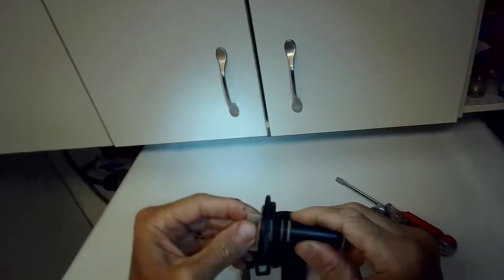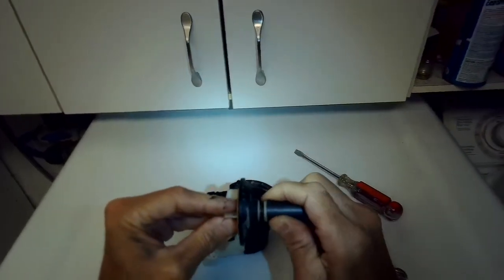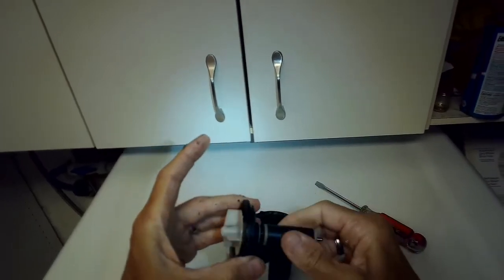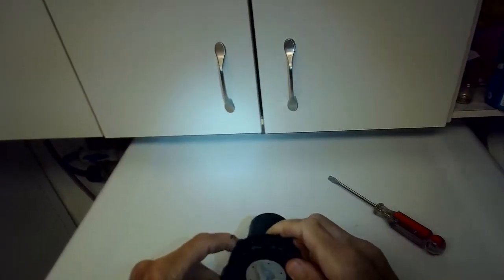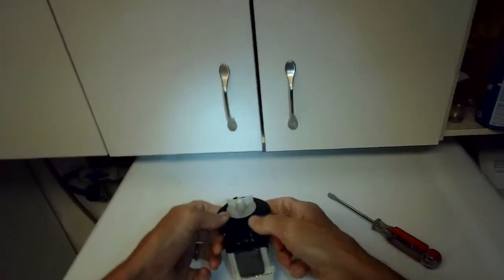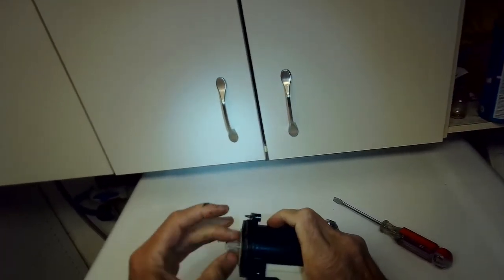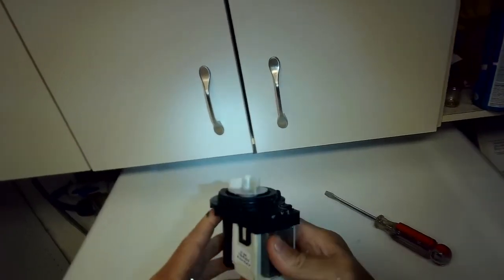And reconnect these. Hold it tightly for at least 5 minutes. Then the magnet and the impeller will once again be one piece. And you can just put this magnet back in and just push this shut. I'd clean up that inside though. Put this shut again. Should get a watertight seal. And you should have an impeller that works again. You should have a nice connection. So hopefully that'll help you.